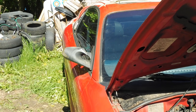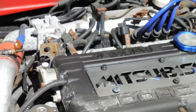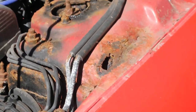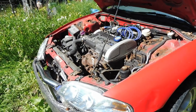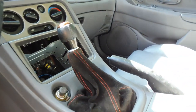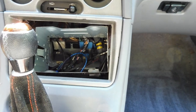Now that I've climbed in the passenger side and popped the hood, I can show you just how bad it really is. This is also a common problem with second generation Eclipse vehicles. I've been talking to Jacob from Rust Belt Garage who just bought a similar 2G Eclipse — the front wheel drive model with the 420A — and his still has the same rust spots. Jacob and I are actually planning to do side by side builds of our red 2G Eclipses, so go check out his channel. Not only are they rusting in the same spots — the rear rocker panels and the front strut towers — but we're also both missing radios. The front speakers are completely blown too.